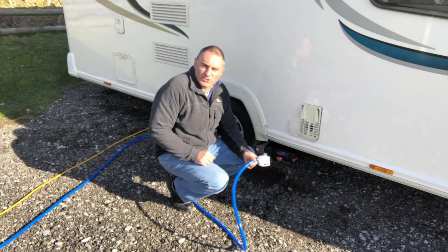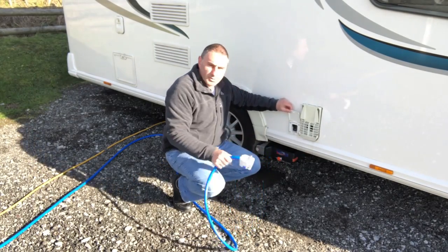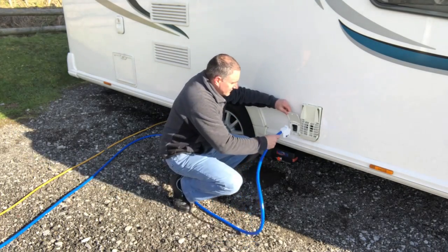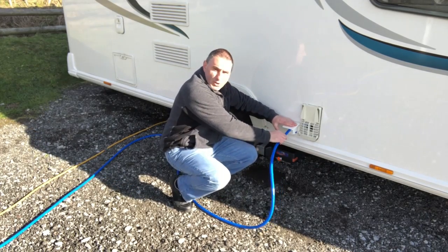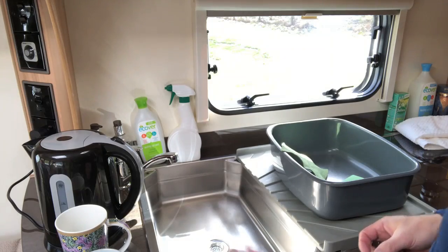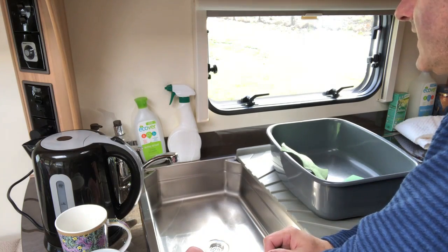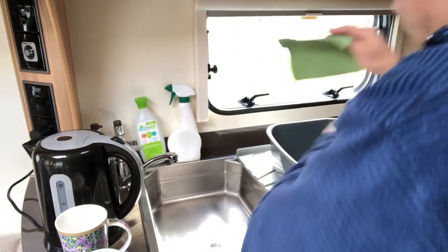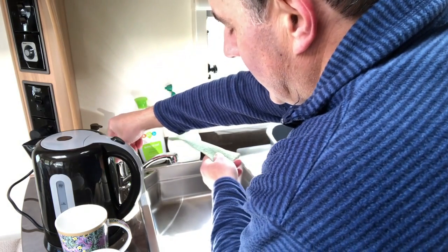Now that the toilet flush tank is full I can connect to the caravan, but before we connect we must make sure all the taps are shut off. The flap holds the plug in place. Now we're on the inside — the drain valve is closed, the taps are closed, and the outside water is connected and turned on. So we'll fill the 10 litre hot water storage tank by letting the air out.